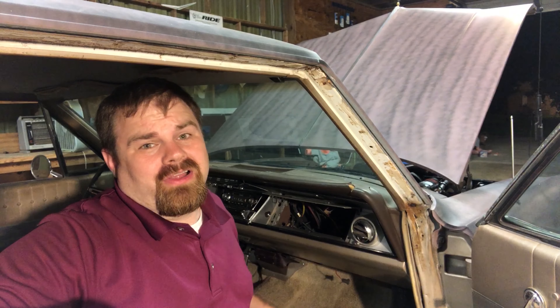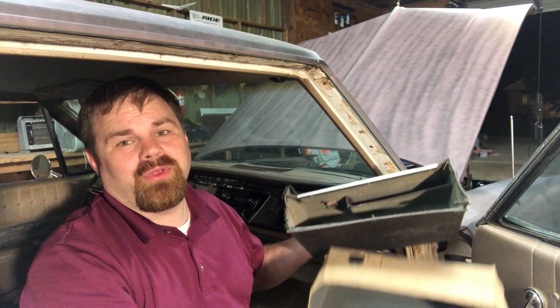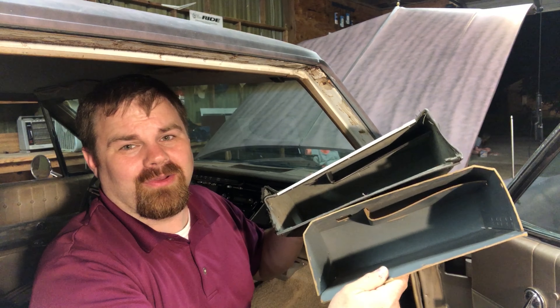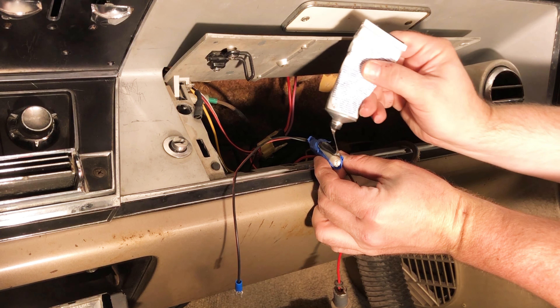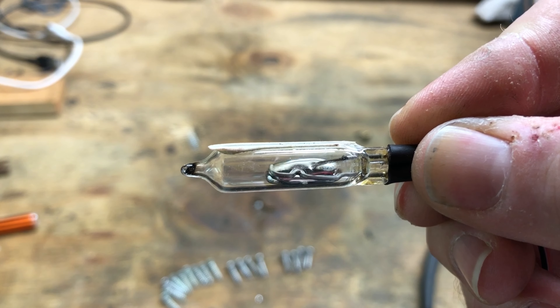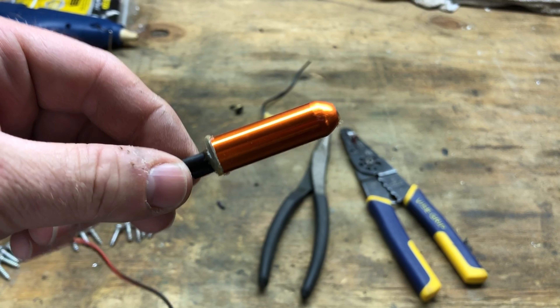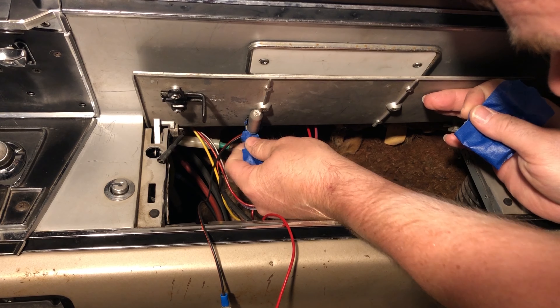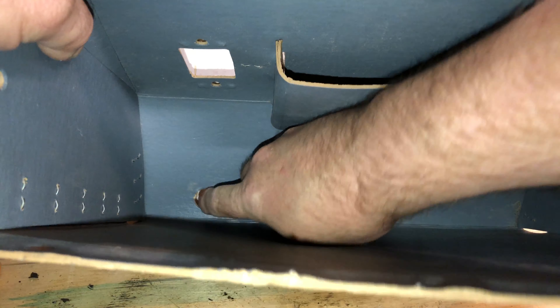It's time to replace the glove box liner. I've got the original one that is really tired and doesn't look great. About a decade ago, I reached out to the guys at Repop Cinema and they made a glove box for me. It's not perfect — it's missing the piping at the front and doesn't have flocking on the inside — but I'm going to go with this one so it'll look better. Before I install the liner, I'm gluing a switch to the bottom of the door to replace the factory one that always made the glove box hard to close. It's a mercury switch which uses liquid metal to disconnect the light when the glove box is closed — the same technology the trunk light uses. I built an aluminum housing for the switch to protect it from physical damage, then painted it to match the inside of the box. Once the gasket maker dried, the output from the mercury switch is connected to the light, and the original supply ground is connected to the input terminal of the new switch. The trunk release hole is knocked out of the liner.